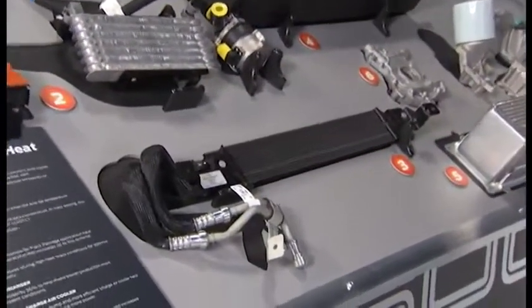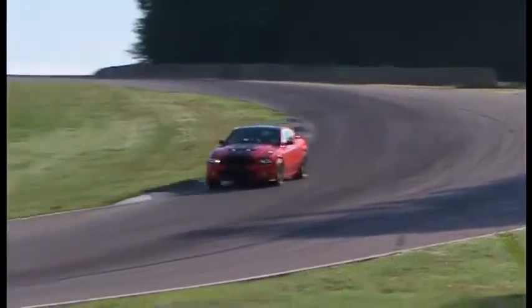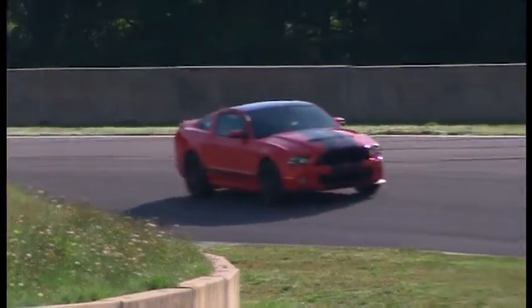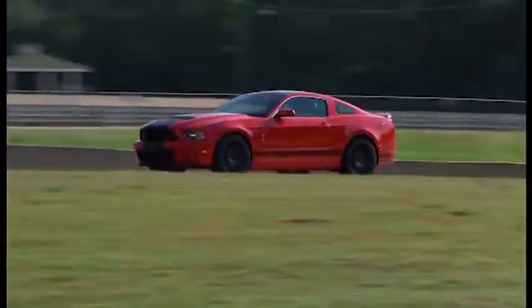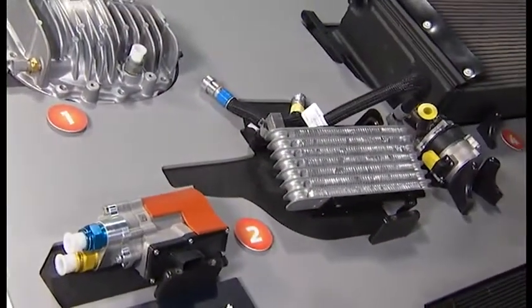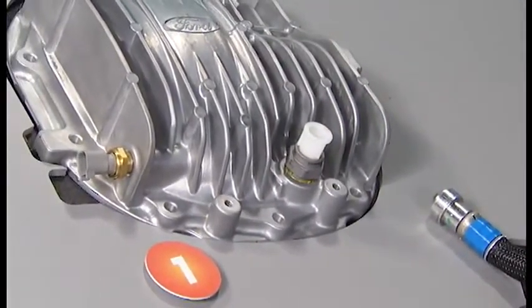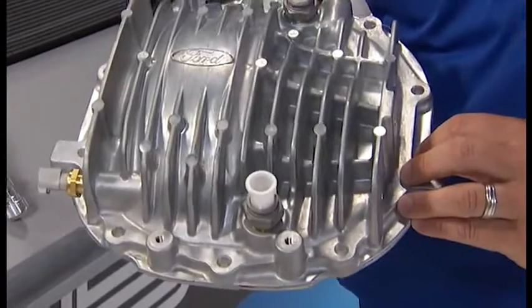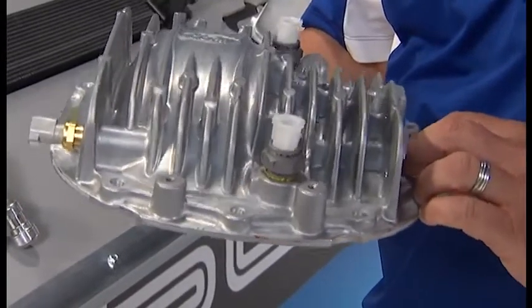The intended use of all of these optional cooling systems is to support the person who likes to go to the racetrack who will have that very high duty cycle on the powertrain — using the 662 horsepower all the time with constant back-to-back accelerations where you're putting tons of heat into all the driveline systems. Next, let's move back to the axle cooling system. We'll start with the finned aluminum cover that is there on all of the cars, both base and optional. It has cooling fins which, when ambient air is directed over these, will reject heat from the axle adequately when you're in typical duty on the street or at the drag strip.